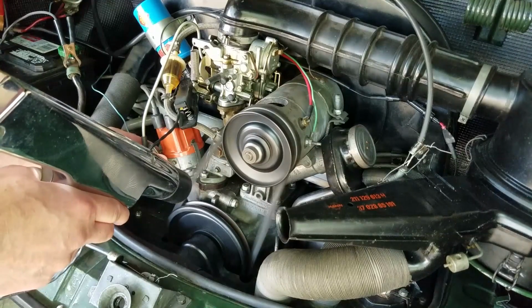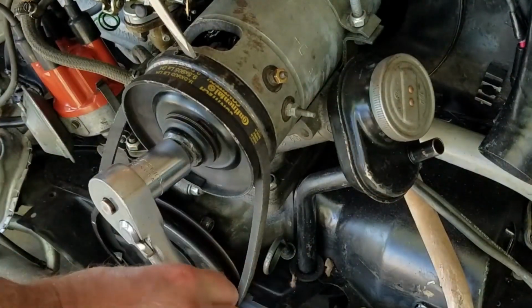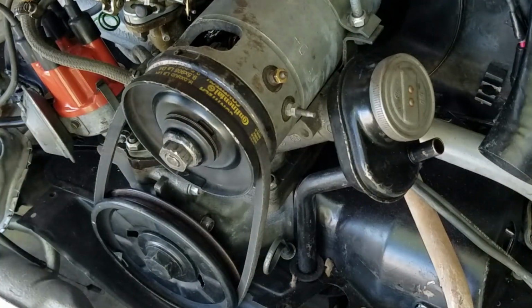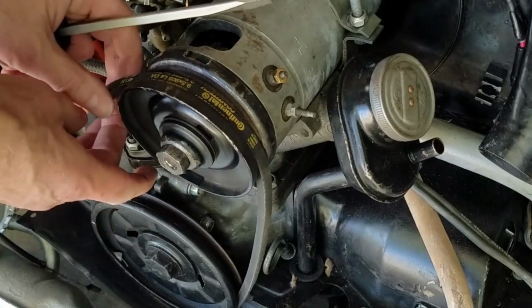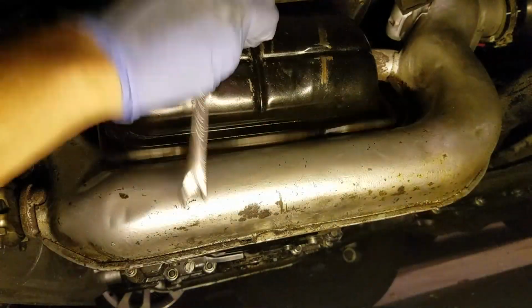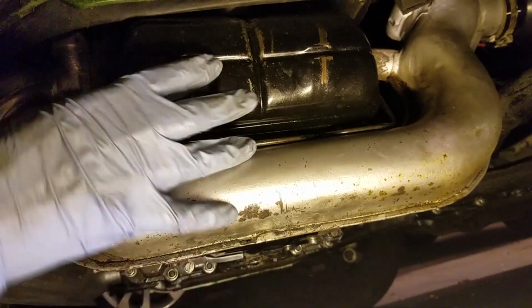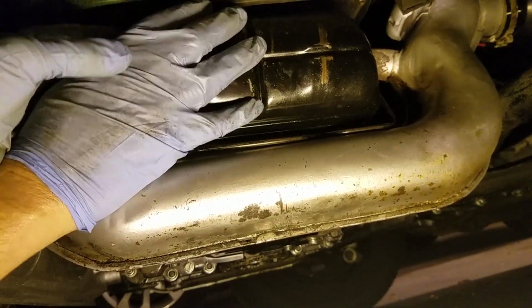The next thing I did was to install the smallest of my generator belts on the engine. The idea was to keep the diameter of the generator pulley as small as possible, thus ensuring the generator fan is running as fast as possible. All the previous things helped a little, but what made the biggest improvement were the tweaks I made to the oil system.